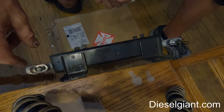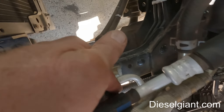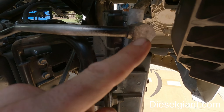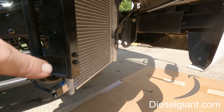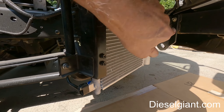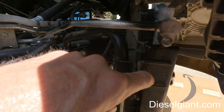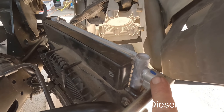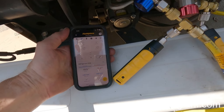The condenser is now on. When you put this on, loosen the nut on the air conditioning bracket enough so the bracket flops around, and put both of the lines on first with it super loose — it's going to look all jacked up but do that first, then tighten everything up equally. Once the two brackets are tight, put the two bolts for the fan shroud. Last, put the two brackets — this will move the line since it likely won't line up. These are torqued to 49 inch-pounds. Once everything is done, tighten the nut back up.